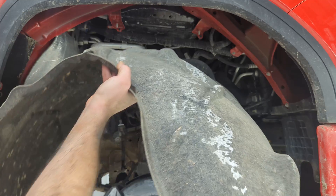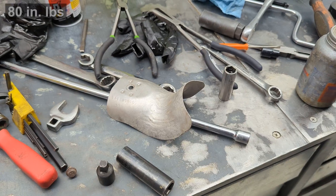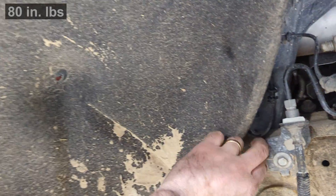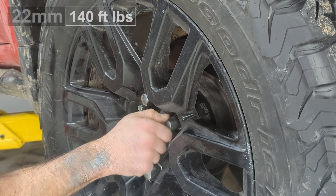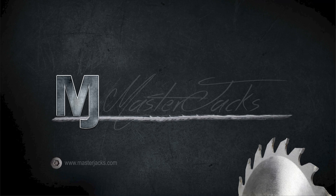I shut off the vehicle, finished putting everything back together, put in the inner fender liner — forgot to put the heat shield on so I had to go back in — and torqued the tires to 140 foot-pounds. She's all done. I hope you found this useful; I appreciate you watching, and hope you'll like and subscribe.